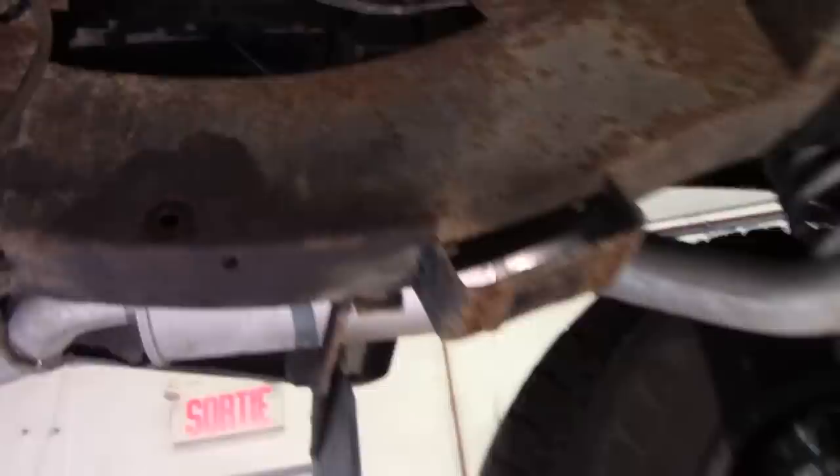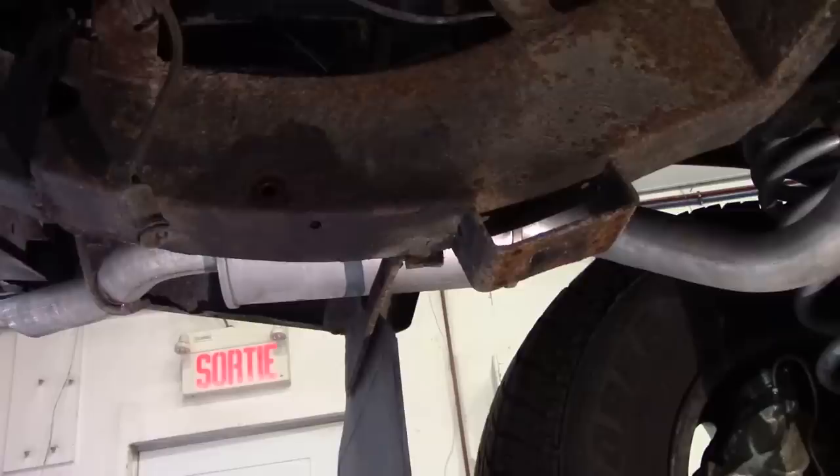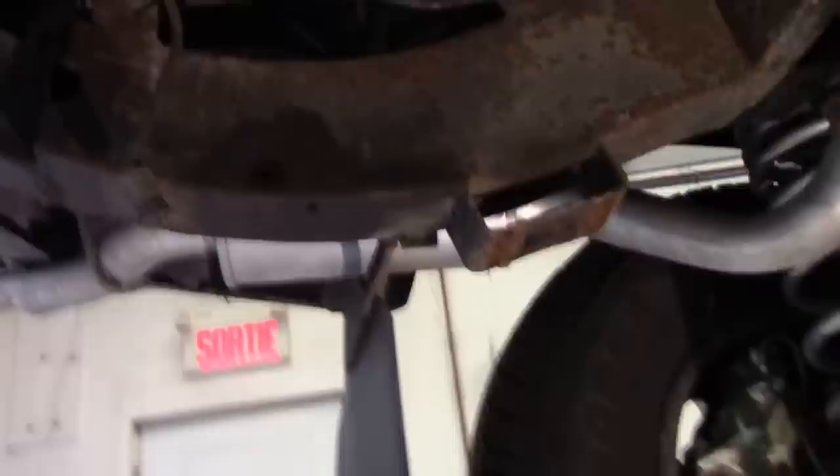The job this morning is to tidy all this up, make it strong, and put some V's in here to tie into this frame. This is always a weak spot on Land Rovers — not so much for strength but for corrosion. These drain holes here block up very easily, and you've got your bolt going through there for your tie-downs.